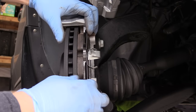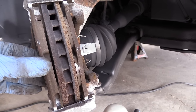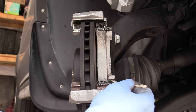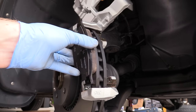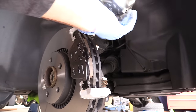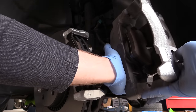Now I'm going to show you how the new brake pads look. Let's put them on — pretty nice thick pads on a new rotor should be nice and smooth when I brake, compared to before with lots of vibration. Next you need to lubricate the area where the brake pad will slide. The instructions also say to lubricate the edge of the piston before installing the pad — I forgot to do that but I don't think it's a very critical step.